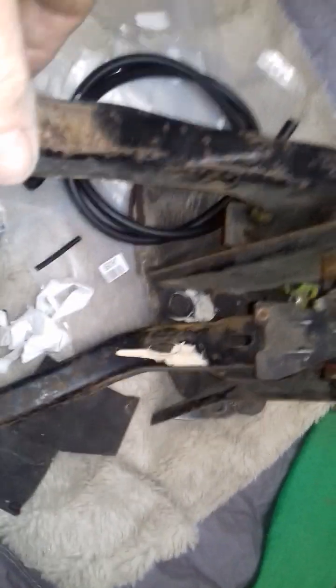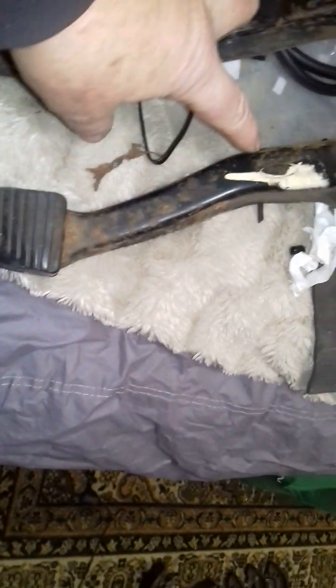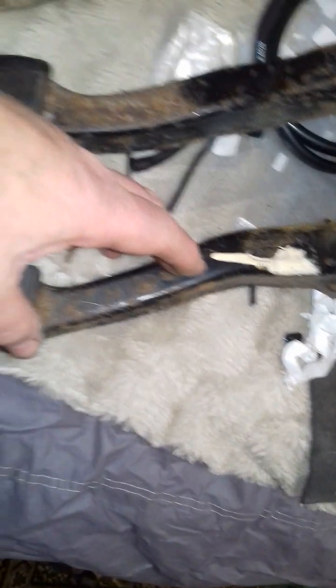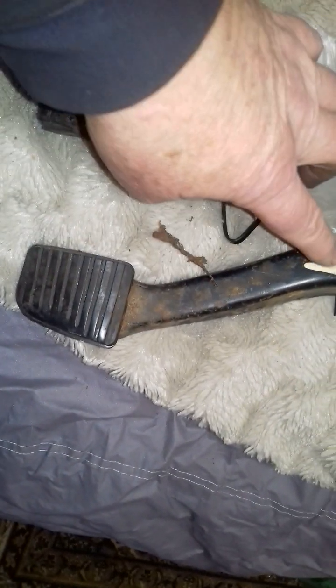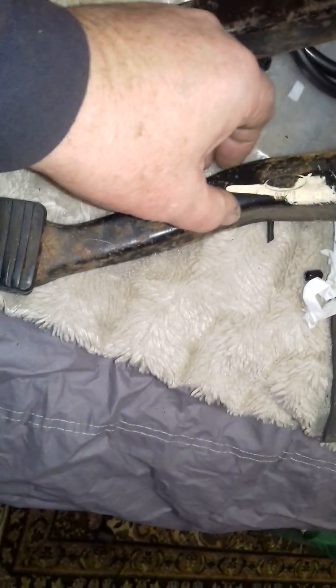It's exactly the same as what's in there. The pedal box is actually at an angle like that. The steering column goes through there, so what I plan to do is cut the pedals here and here and move it over. I've got to cut it about there because that's where the steering column goes through. Keep the length exactly the same so the ratio is exactly the same, but cut that and move it over so that the brake pedal's about there and the clutch pedal's about there.